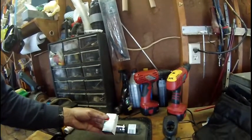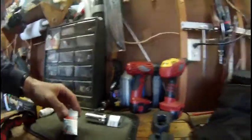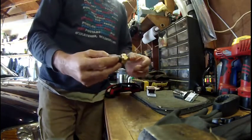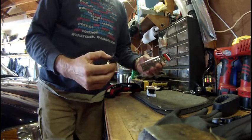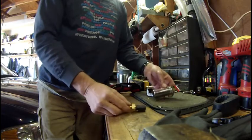We are going to replace the oil sensor on my 2002 Jeep Grand Cherokee. We're going to have to get underneath here and replace that oil sensor that is up behind the blue oil filter right there. I'm probably going to have to take that blue oil filter out to be able to get to that sensor. I bought a 27 millimeter ratchet so I can get that oil pressure sensor out.